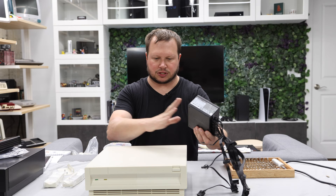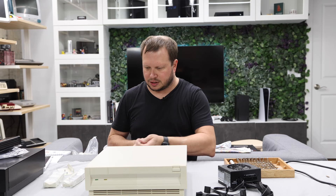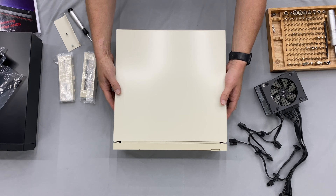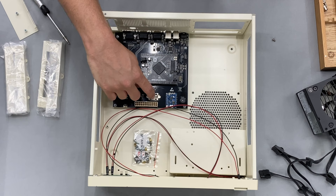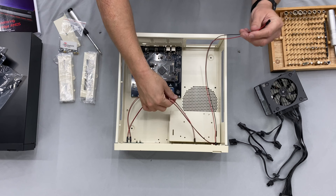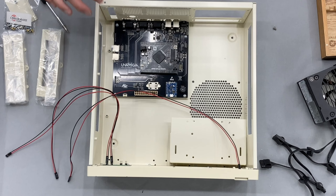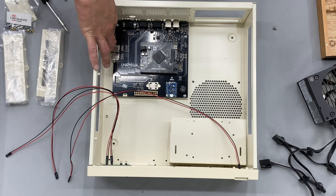Let's start by putting together the unamiga. We just need to put the power supply into the case. There are two screws on the back — unscrew those and the top slides right off. The unamiga is inside and needs a battery. The front panel connectors include a power switch, power LED, and hard drive LED. It has a micro SD already set up with Amiga OS 3, so it should be ready to go.